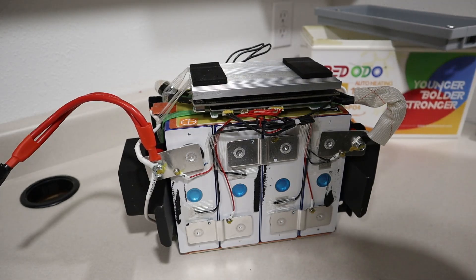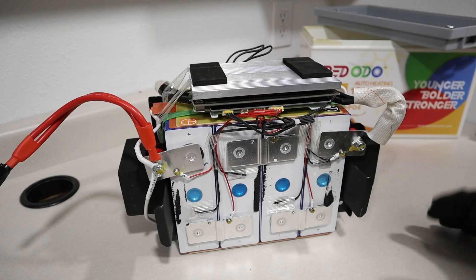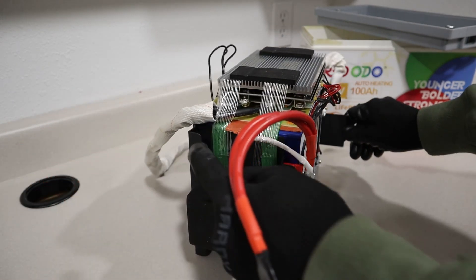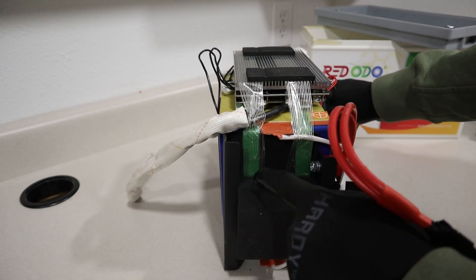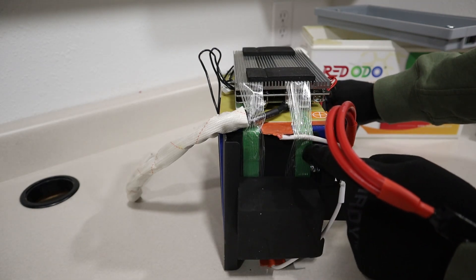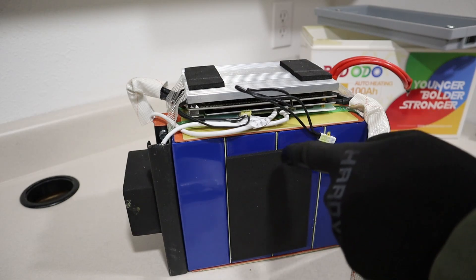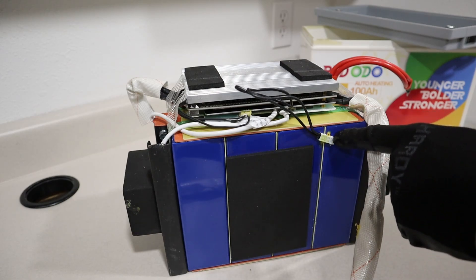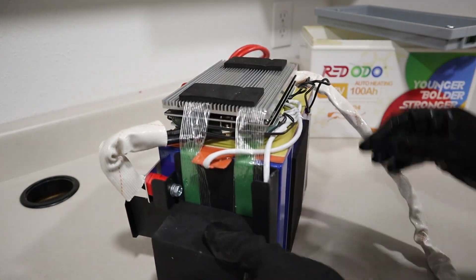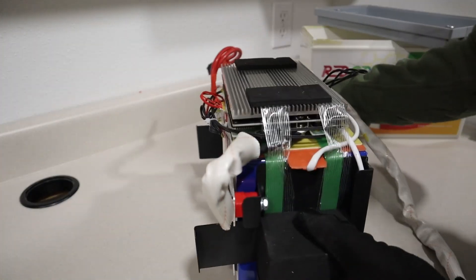That was one of the hardest batteries I've ever had to remove from a case — it was glued down on the entire bottom of the battery, which speaks for the durability. Looking at the battery itself, you have two metal plates on each side compressing the cells together with heavy-duty nylon straps. Looking at the back, you have four prismatic cells with fiberboard between each one, a high temperature sensor, and the BMS on top. You also have a heating pad on top and another one on the bottom, which we'll be testing a little bit later.